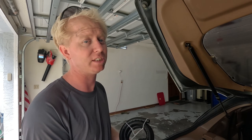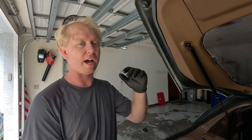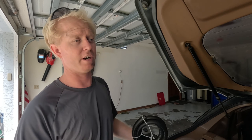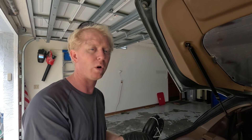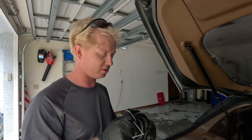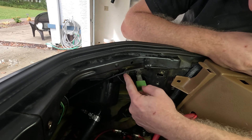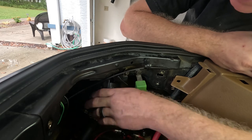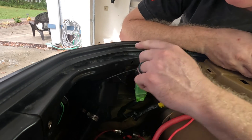The reason I'm running an external reservoir on this pump — many Volvo pumps like this come with a built-in reservoir and cap that you can fill right on top. However, because I'm mounting it sideways, I want that reservoir to be 100% full all the time and don't want to risk it running dry and burning up. So I'm running a reservoir up top that will gravity-feed into the pump to keep it full. I have some 5/8-inch rubber hose that should slide right over the nipple on the pump reservoir. I'll mount the power steering reservoir right here — just one bolt holding it for now — and I have my 5/8-inch rubber hose running down through the hole in the back.